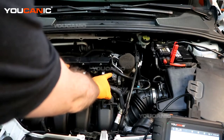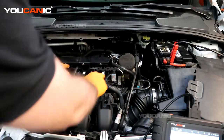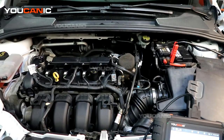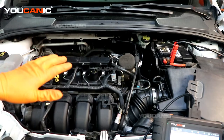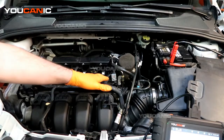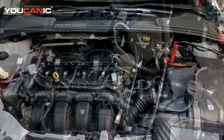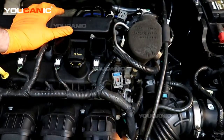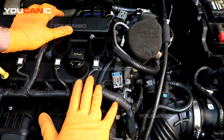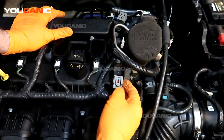To remove the sensor, we need to undo the connector — squeeze it and pull it off. We're going to try replacing the sensor itself, the electrical sensor that may have gone bad. If the code comes back on quickly, we know there might be other issues, such as timing being out of alignment. The sensor is right here at the front of the engine. If you have a decorative cover, remove that first, then squeeze the clamp and pull it to undo it.